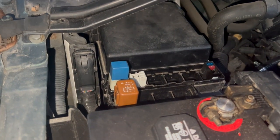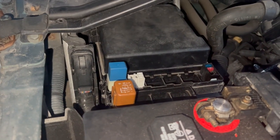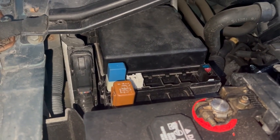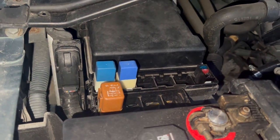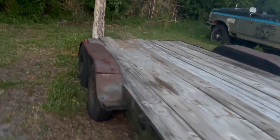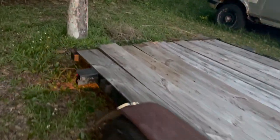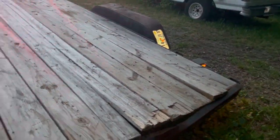When I started troubleshooting I realized we have the right-hand blinker relay but we have no left-hand blinker relay. Popped in a new relay and what do you know — got working trailer lights.